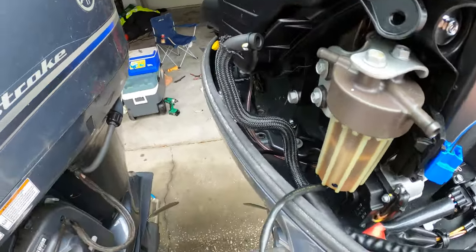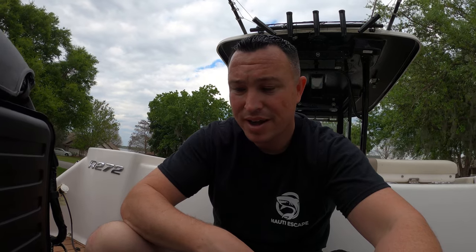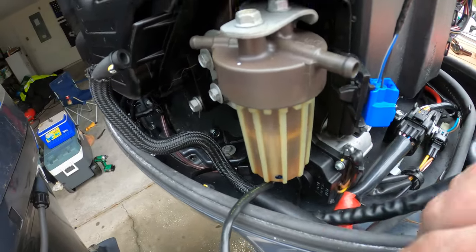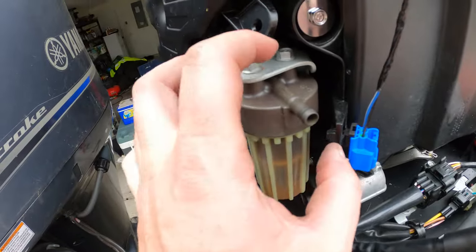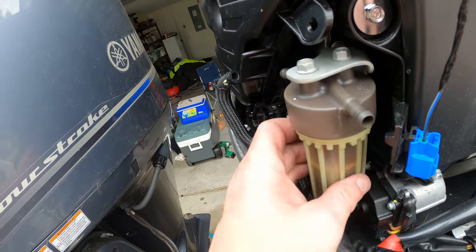There are a couple ways to do this, but there is a special tool for it. I'll put a picture of it on screen and a link on Amazon to buy it, because it will save you tons of time. This is probably going to be your biggest pain to do because you don't want to break it — this part is plastic. Take these two bolts off. You will not be able to take it off by hand. I watched somebody say you can take the whole assembly and put it in the freezer for about 20 minutes, and the o-ring will retract because of the cold.